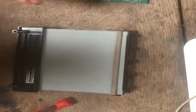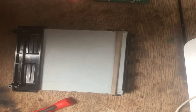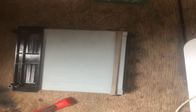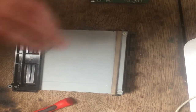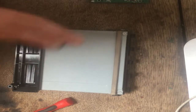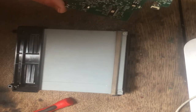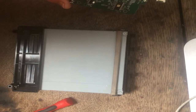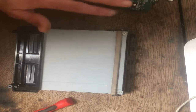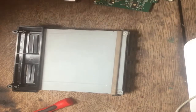Hi, welcome to my channel. In this video I'm going to be showing you how to change the disk drive on your Xbox One. This is an Xbox One original. When you change your drive, it's not going to work — it's not going to recognize disks or anything like that — because you need the original daughter board. This chip here is matched to the actual console, so you will not be able to update or do anything if you just put a new disk drive in.